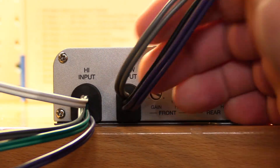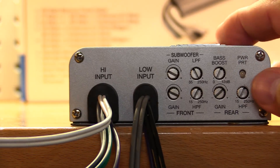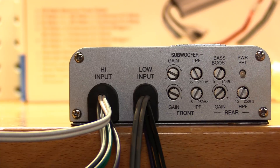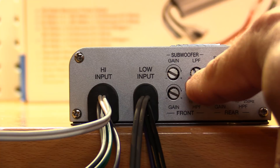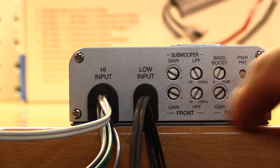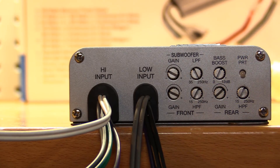After working through the manual you find all five speaker connectors. In a car this seems redundant, but Clarion did say this is a marine amplifier — and raw wire connectors, if you're soldering them in, really are the best connection you can have. You can fully seal along the wires going into the amplifier and you don't have any gaps letting in moisture, dust, debris, or salt water. On the other side we have settings and all six RCA ends, plus high-input adapters. Settings are very basic: gain for subwoofer, gain for front, gain for rear, a low-pass filter adjustable from 250 Hz down to 35 Hz, bass boost for the subwoofer, and a high-pass filter for front and rear channels ranging from 15 Hz up to 250 Hz.